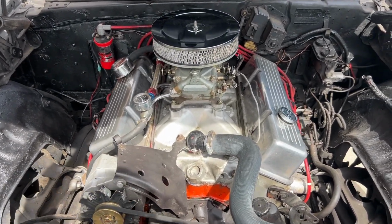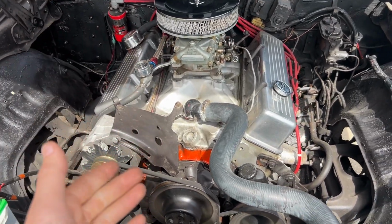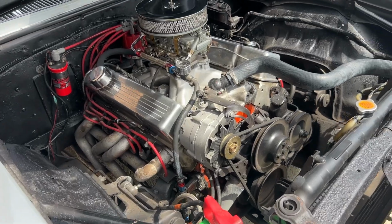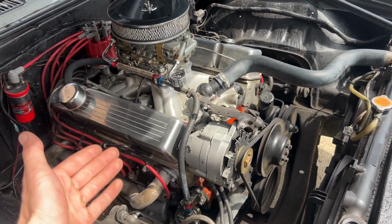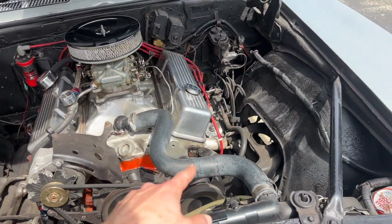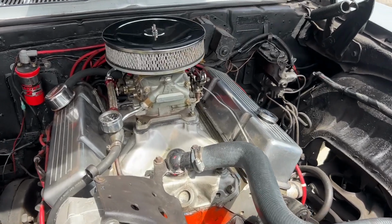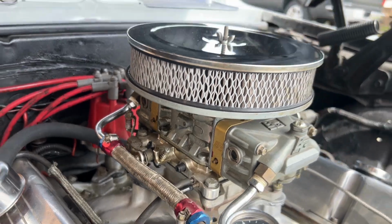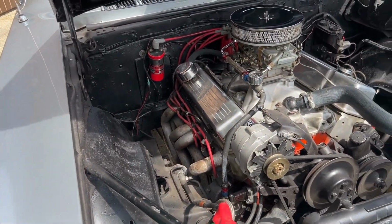Anyway, it's a 350. I was told it was a 355, which again, I believe it could be, because you don't achieve this level of performance in a stock 350 without doing a little work to the bottom half. The previous owner rebuilt the top half of the engine himself, upgraded it a little bit. Again, the Brodix aluminum heads, the aluminum intake, the nice carburetor on there. It's got solid lifters as well, so it's pretty quick.